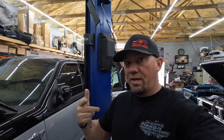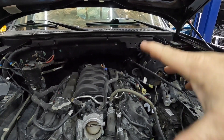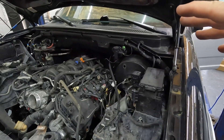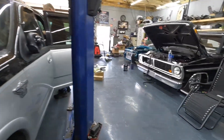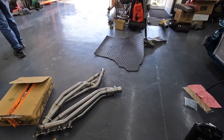Here are a couple of things we've been waiting on. We needed an engine harness and trans harness — the factory one. We're going to send it over to our buddy Nathan Hensley, who's going to make all the stock gauges work, including the PATS system. Adam's harness actually went with the old motor, so we've been trying to source another one. The other big issue is they don't make a swap header for the 97 to 03 F-150s, so I've been working with my buddy Alex Civiletti at Holley, and I think we may have it beat.